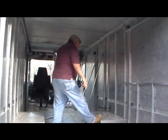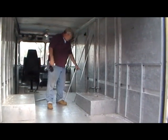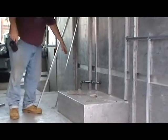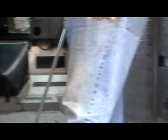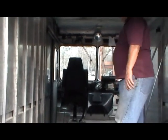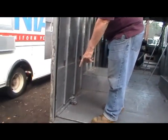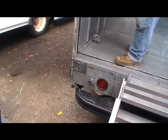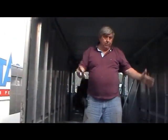You can see the fender wells in here. We've already run gas lines in this truck, brought up to where the manifold is going to be. This truck is going to have a generator built into it. There's a gas line running across to the other side with another regulator down to half a pound, then it comes to the back. There will be racks built above the lights, 100-pound tanks here, a wall across, and a door in the center just like the truck next to us.